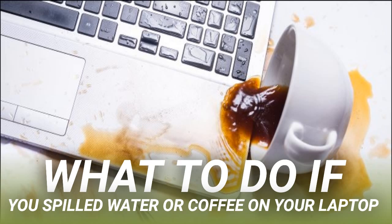If your laptop has a removable battery, take it out, dry it off if necessary, and then put it somewhere safe. If you spilled a lot of liquid on your keyboard, you might want to try placing your laptop face down on a towel with the lid open, like an upside-down V. This allows droplets to drain before they reach the sensitive components underneath.